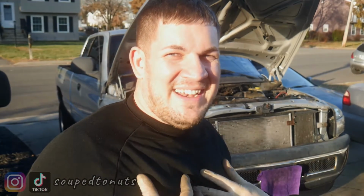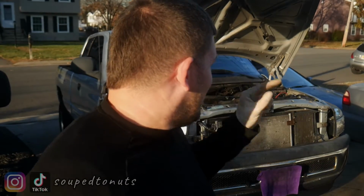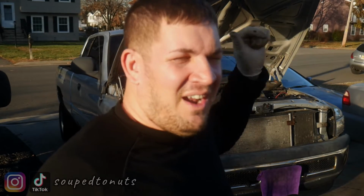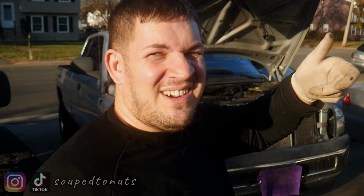I say we a lot, but I'd appreciate an extra set of hands in terms of good old wrenches. But it's just this guy here. I'm going to be replacing the pitman arm and the stabilizer arm underneath, that I'll show you in a second. And I also have to test to see if the throttle position sensor is bad or malfunctioning, with a voltmeter. There's a bit of a process, it's supposed to have a range of certain volts when you twist it.